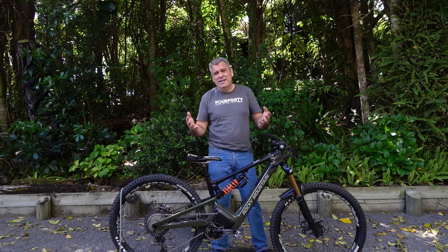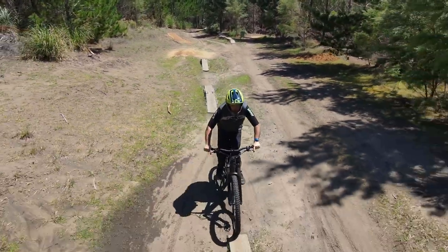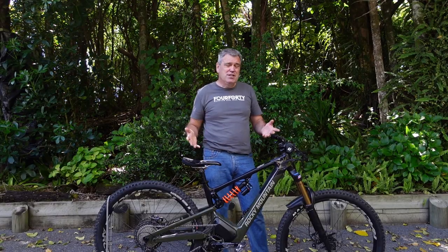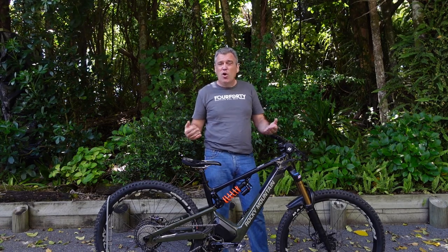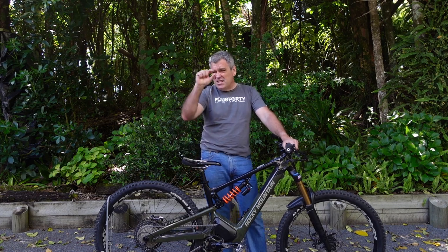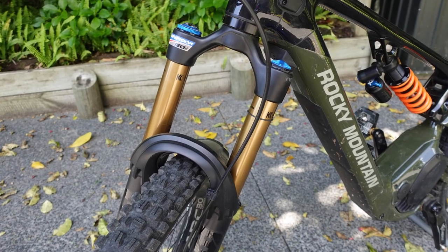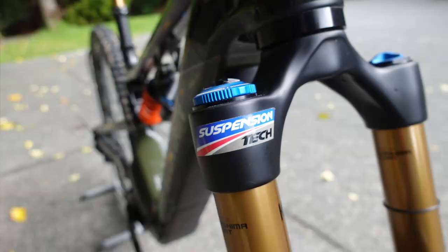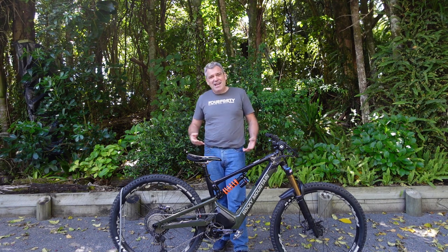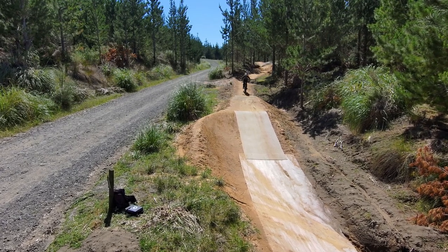Now for those of you - I do need to say something before we go too far. I've said this before, but many of you will be looking at my handsome face for the very first time. I'm not a professional YouTuber, I don't do this for a living, and I do have limitations on these reviews. In many cases I just have the bike for one day, and that's the case here. Sometimes the size is wrong, the setup's wrong. The rider of this bike is 72 kg and I'm just a smidge heavier than that, so that meant it was soft on the rear end. I changed the fork from 70 psi to 100 psi - that gives you an idea of how much we were out. I also did a bit of pedal strike and I'm pretty sure that's because I'm just sitting a bit low in the travel.